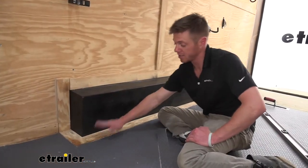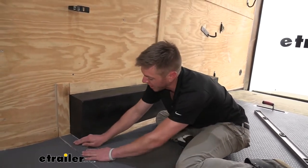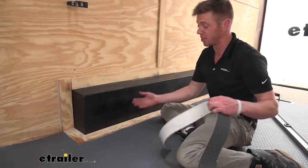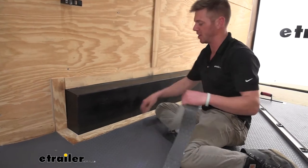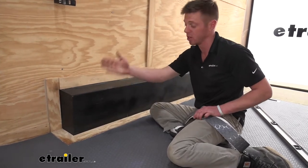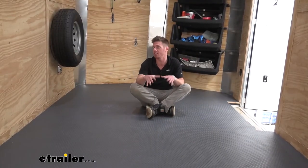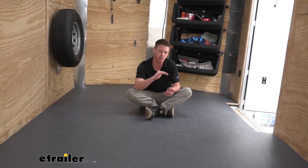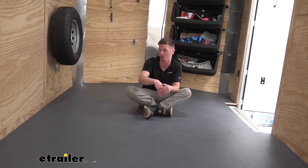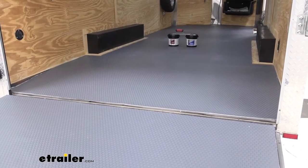The reason we are not putting vinyl over this little raised section is because if we were to lay it over that, we're going to have a little air gap — it's not going to look flat and it will eventually start to pull up. Stuff can get down in that little crevice and we don't want that. So be mindful that if you have something like this around your wheel wells, be sure not to go directly over it. One piece of advice: if you're cutting off material, cut a little bit less than you think you need, because you can always take off more material and you can't put it back on.